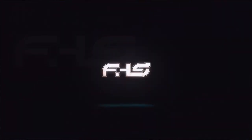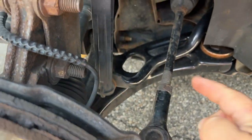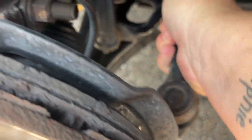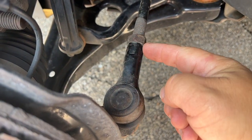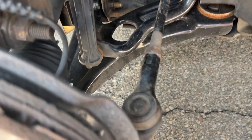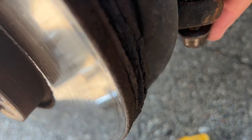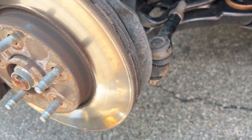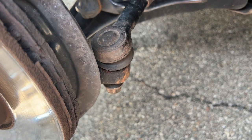So we've got the wheel off here. This is the tie rod coming out, and this is the end — this joint is bad. What's great is you only have to replace the end; it unscrews here. You loosen the nut and the whole thing comes out. There's a nut on the bottom — I've already broken it loose. You'll need a breaker bar. If there's a cotter pin, take that out first. You don't have to undo any of the suspension — just go ahead and take that nut off.